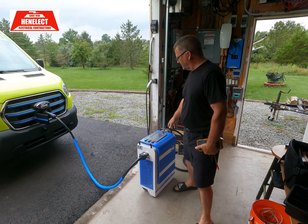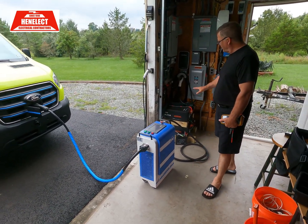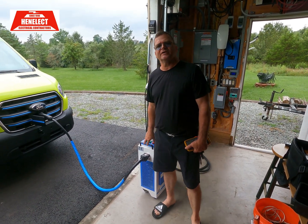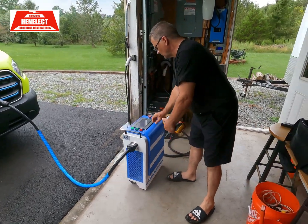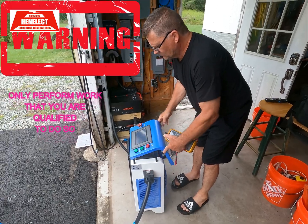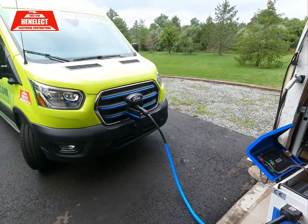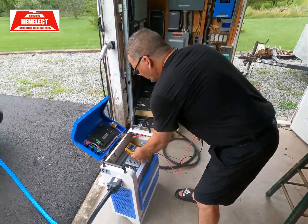I can't do that yet. So what I've done is set up this DC fast charger. It's already configured — it takes 100 amps from my grid, steps it up to 385 volts, and feeds the van. Let me show you. I'll hit start, and I can hear the vehicle communicating. It's starting up — I just heard it click on.